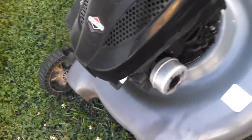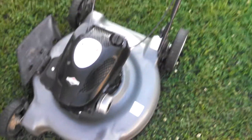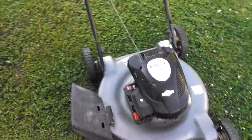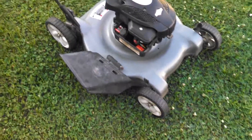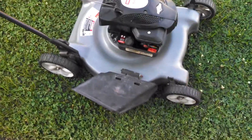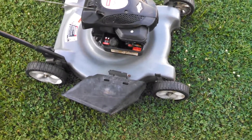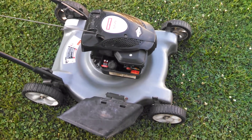When I got it, I could tell what was wrong with it. If you could see black around the muffler, that was a bad diaphragm. So I put a carb kit in it, cleaned it up. It didn't have a chute on it, so I rigged up a chute off another one that I had. Should be all right. I also cleaned the plug and changed the oil.